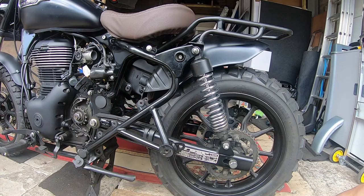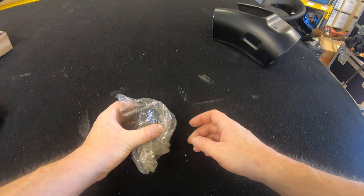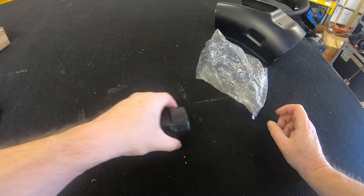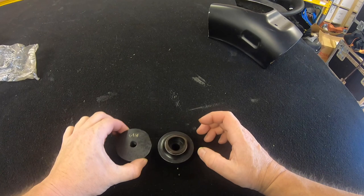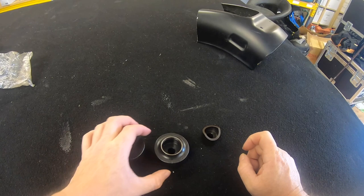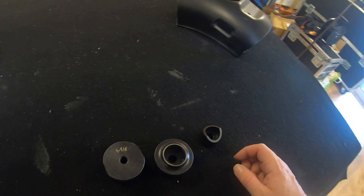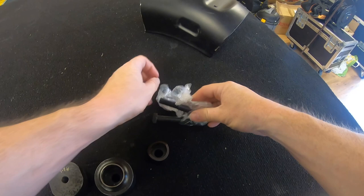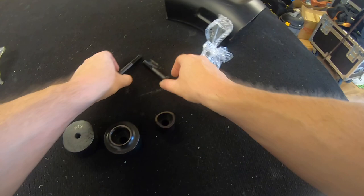What I've got here is a special tool called a flaring punch and die, which is for making the type of holes I want in sheet metal work. And what this does is there's a bolt, and you drill a pilot hole that's the right size for this bolt. I've been sent two bolts, which is nice. Probably because they wear out, I'm thinking.